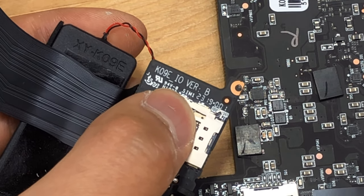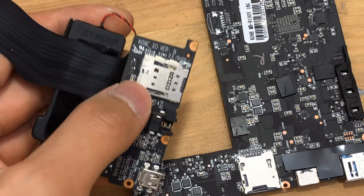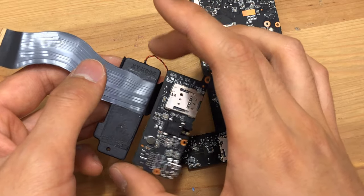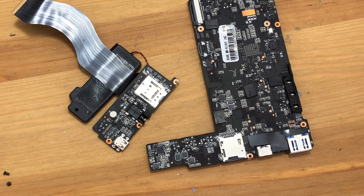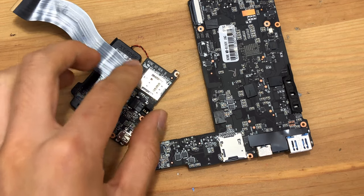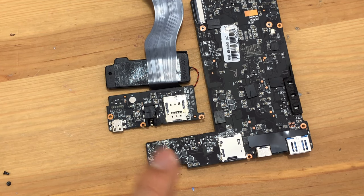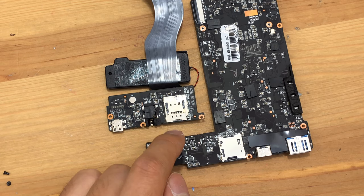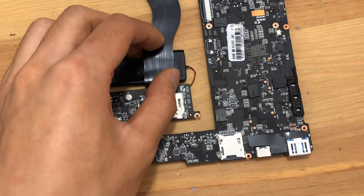It says SIM1, and there's no tray. This is actually on the IO board, in a consistent location with where the external SIM tray was on the casing of the prototype picture that was circulated. What's very interesting is: if someone with the regular OneMix 3 could check inside and see if they have that slot, because that could actually make LTE viable on the 3, since that one has an M2 slot.